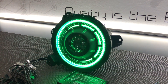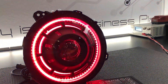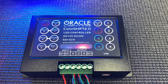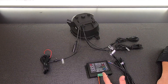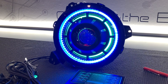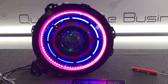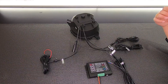Connecting all elements the same way will make the light illuminate with each element the same color. If you wanted the elements to be different colors for more contrast, you could connect element one as RGB, element two as BGR, and element three as GBR. So when you set the color to red, the outer halo would be red, the inner halo would be blue, and the demon eye would be green. As it changed colors, the elements would continue to change and always have a contrasted look to them.